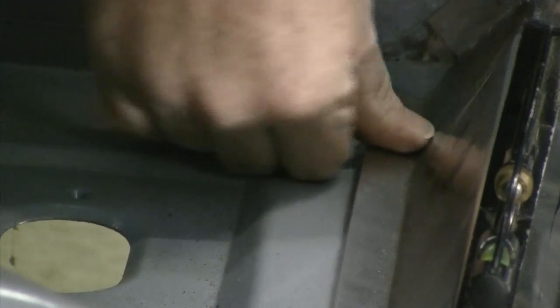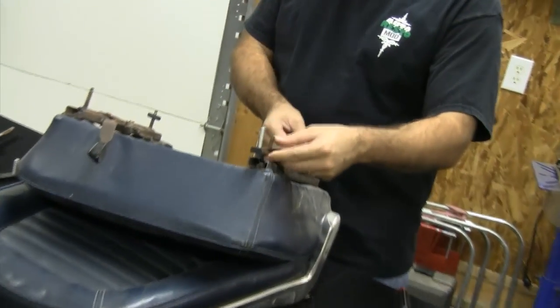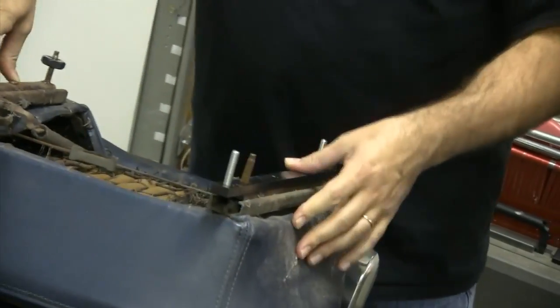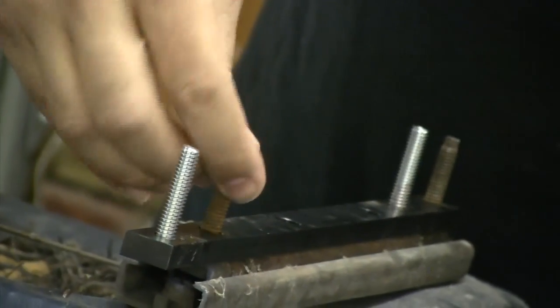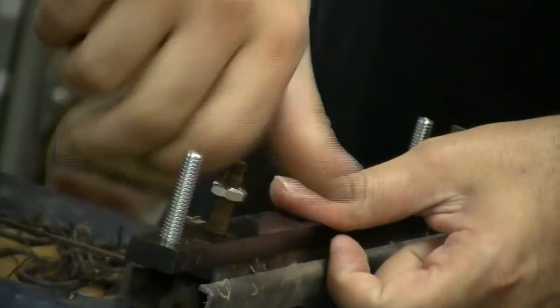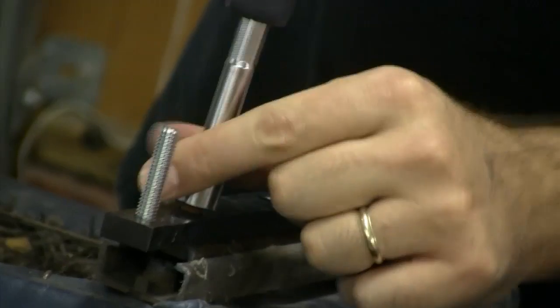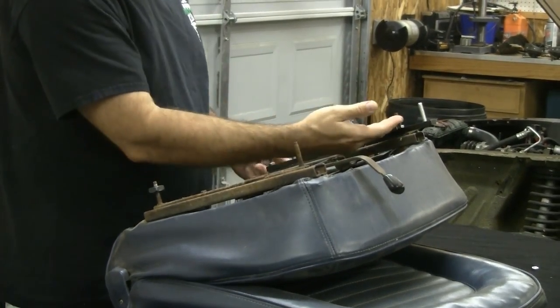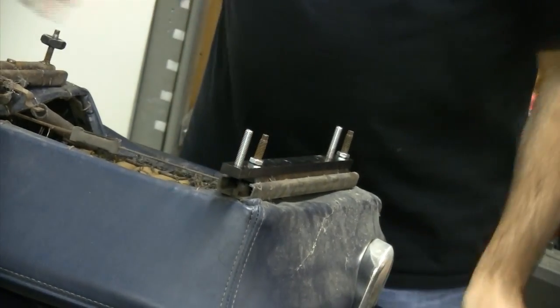Now that the pan's where it needs to be, I'm going to take this edge and bump it back and down just a little bit and start welding this in. While I'm working on this, Vinny's going to talk to you about the seat extenders we're putting on the seats. The seat extenders are very easy to install — they just slide right on top of the seat studs. You've got two pegs on either side and holes right on the new seat extenders that will go right over the pegs, and then you just bolt them down. When you do a final install on these, you'll want to go ahead and use Loctite on these nuts. Right now we're just doing a fit test. Once you have the nuts snugged down good, you're going to trim that bolt flush with the nut. We also ran a die down the old stud just to make it a little easier to get the new nuts on them — they get a little rusted up and corroded, so it just makes installation a lot easier.